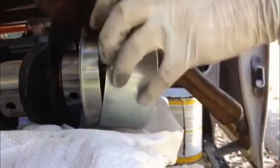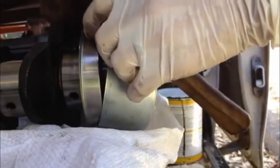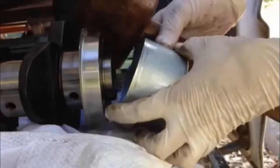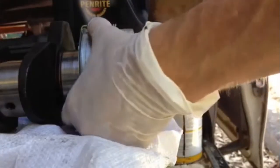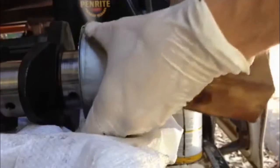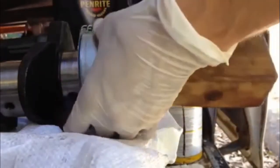When you tear it off it should tear off at this line here — opportune word, it should. So that part you don't want to have back behind the back bearing surface either. Now when you get these, unless you're really really good at doing your measurements, you do what I do just to be sure and you actually take your crankshaft down to the bearing place. They measure it, check their catalogue, and give you the part you need.